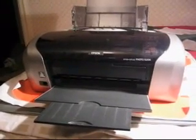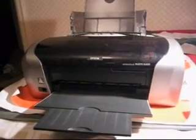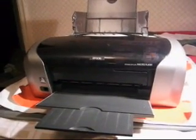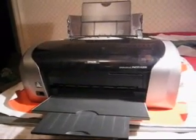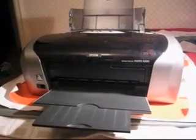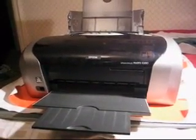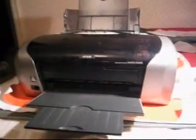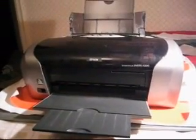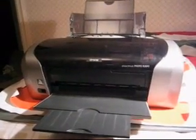One of the things they do is, when you clean the inkjet heads, or there's any excess ink, the printer has to put it somewhere. Where's it going to put it? It can't obviously just shoot it out. And what all these printers have got is a long piece of absorbent material in the base of the printer, and that's where they actually put all the excess ink.